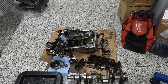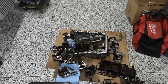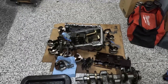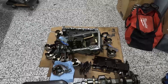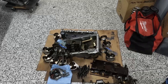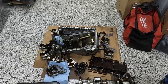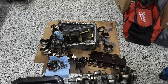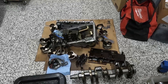Taking the pistons and rods out, the rod bearings looked okay — there were a couple that were a little scratchy. This car has always had weird oil pressure issues I could never really figure out. I did upgrade to the big oil pump and that helped a ton, was good for like half the year, but at the end of the year things got much worse. I put in 20W50 and they got slightly better, but yeah, things just got a little bit weird at the end and I couldn't figure it out.